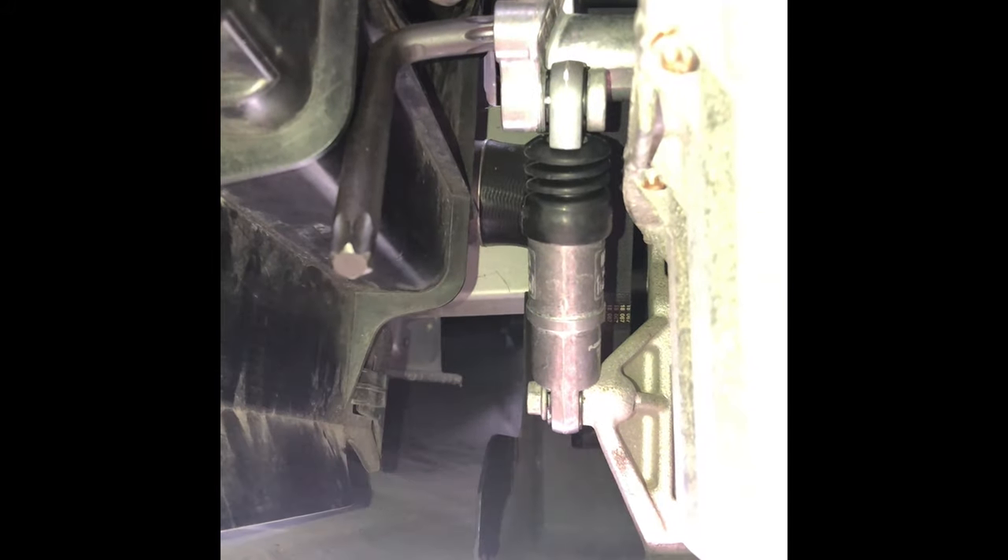T55 L-shape Torx head — and this slot over here on the belt tensioner. You pull it downwards and you need an extension to give you more force. I use a regular wrench, or if you have the right length of tube pipe, that'll be better. You pull it downwards, the belt releases its tension, and you can pull it forward to take it off from the pulley.